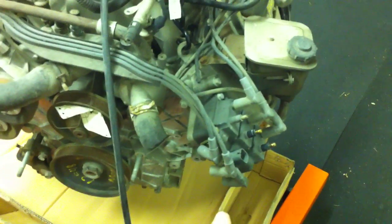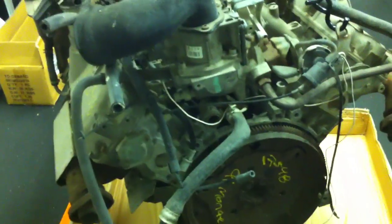This is the newer version of the Eagle Premier slash Dodge Monaco engine. You can tell because it doesn't have the distributor — it uses coil packs instead. It's a little hard to see because everything's gray, but you can also tell because the water pump doesn't have the little black tubes going into the heads from each side. It's a newer revision of the 3.0 PRV engine.